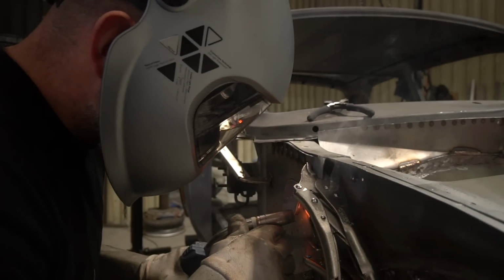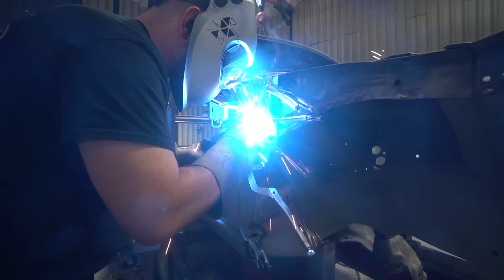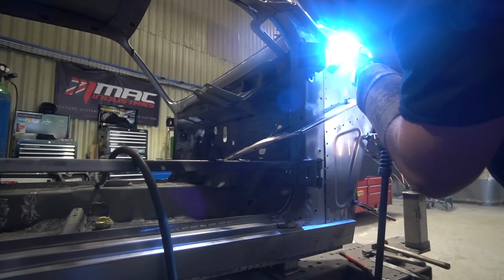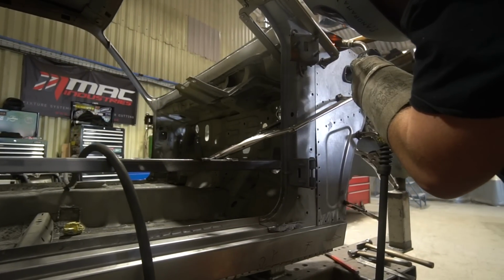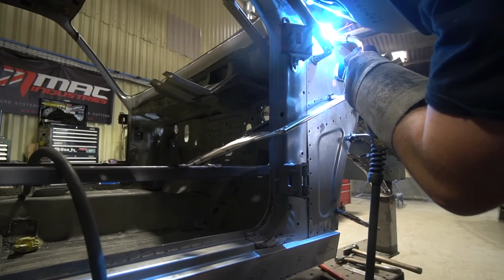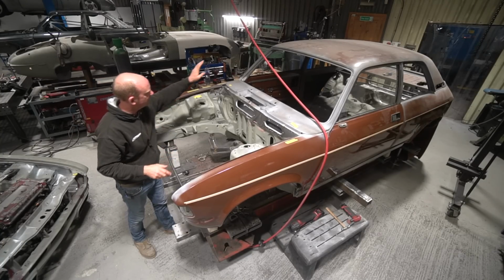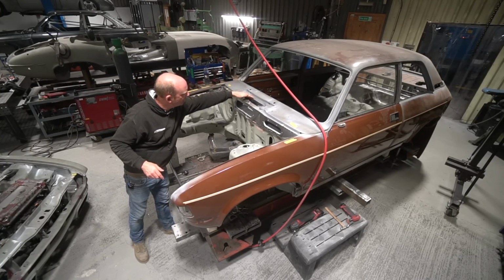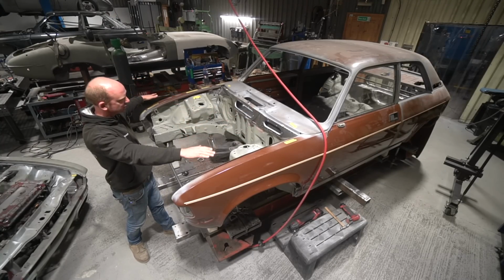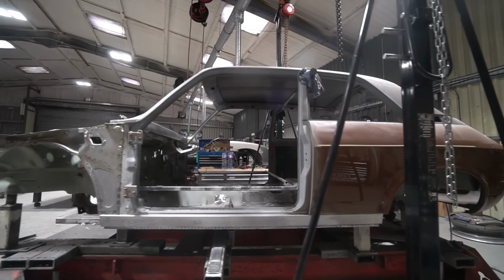The outer A-pillar closing panels have now been fitted, following the fitment of the reinforcers that go inside them. Again, I think last week I mentioned those reinforcers. Well, they're now spot welded in place, and then the A-pillar outers are welded on, all spot welded in place. And then the drains put through, and as I say, continuous welded around the outside. So now all the rainwater that runs into here goes into the air intake here, runs across to the two sides. That all drains by gravity out to the sides, then runs out through those drains and ends up under the wings on the outside there.